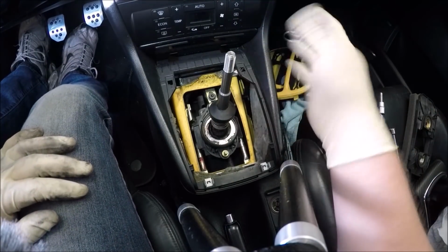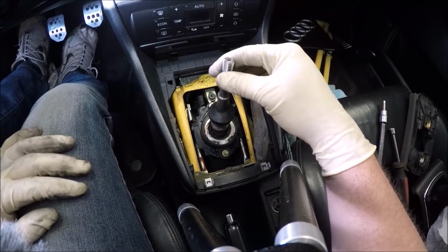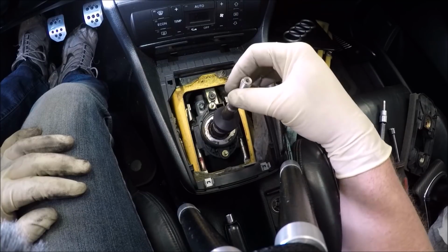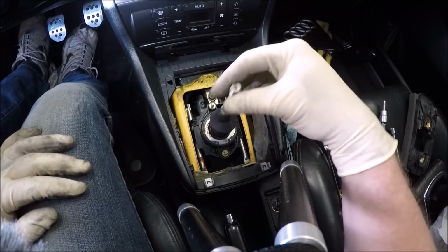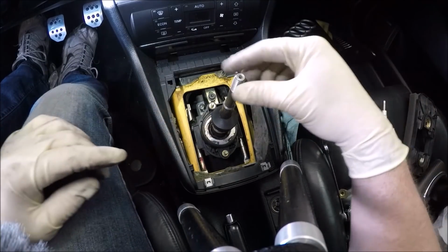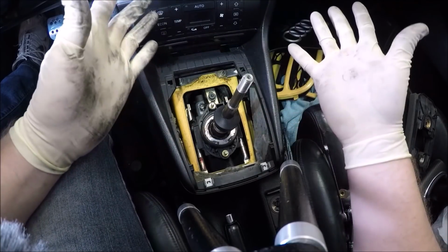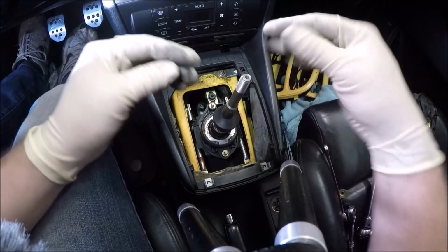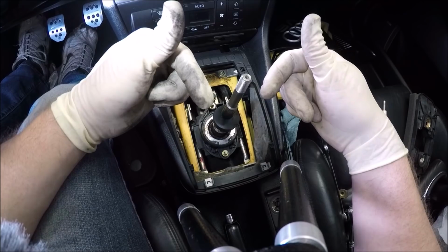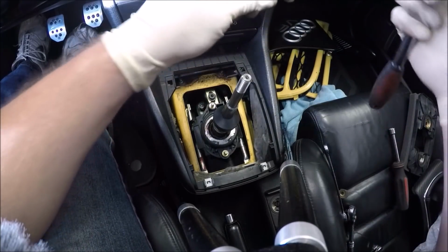And then the shifter, you could get a degree counter if you want. It's supposed to be, I think it's 9 and 2, so 9 degrees back and 2 degrees to the side. I'll put it in the description below, or right here. So it has to be off to the side a little bit and back just a little bit, and that's how you know it's correct. It's never straight up and down. It's back a little bit and to the passenger side just a tad. And that's usually where you want to start.